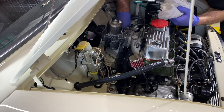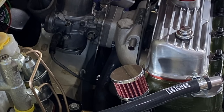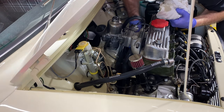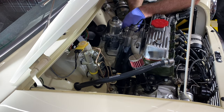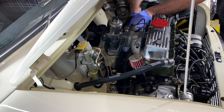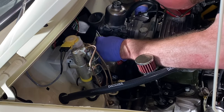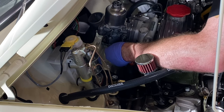When we were rebuilding the car I didn't have all the required pipework, so we fitted this setup as a temporary measure just to get the car working for Bingley Hall. The problem is the rubbers are perished and it's sitting too close to the exhaust manifold. The exhaust isn't standard and that creates further clearance issues. I'm also using a mechanical fuel pump, which doesn't help matters as the fuel pump is right next to the exhaust.